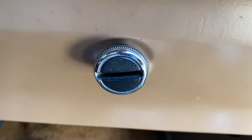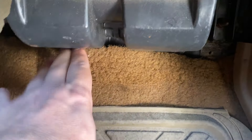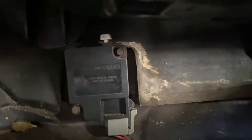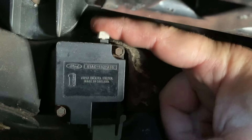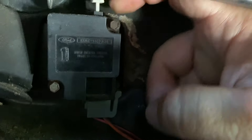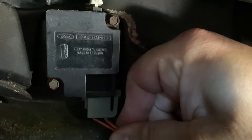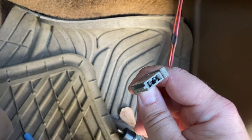Right here — here's the carpet. For reference, there's my glove box and glove box handle coming down. Here's your carpet — pull it back. Look right there, that's the inertia switch. Now on the top, in a perfect world, this is a reset button and it should work. This one's knackered, it's not going to do anything. There's one plug, one pigtail that goes into it. Pull that plug, bring it forward, take a look at it.